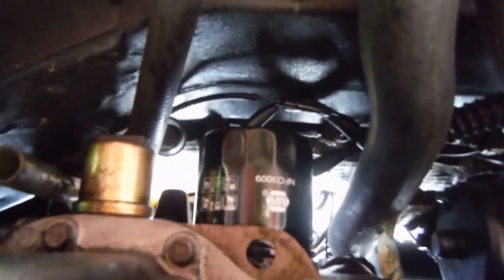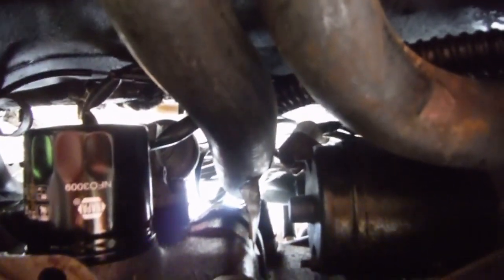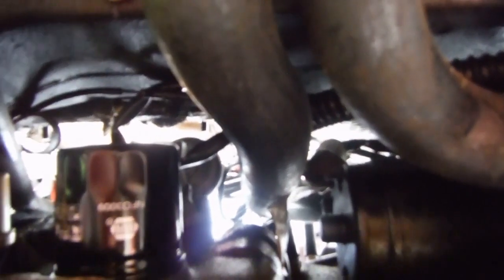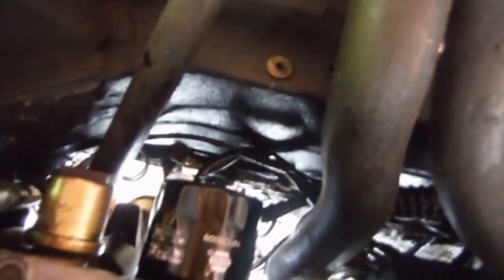So now you'll see, I hope, it's on and I've cleared up and you have a little look underneath, and I've seen something: the oil pressure sender is rubbing against the downpipe from the thermostat, so that's not a good thing. But I'm looking at other things under here, the starter motor, how I might get that out if I needed to. I think I'd probably put it on a 4-post or always take it to one of my mates. But just generally having a look around, see if there's any obvious things.